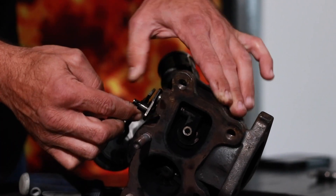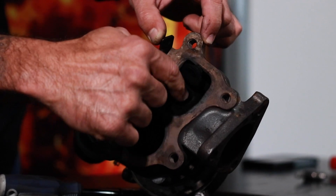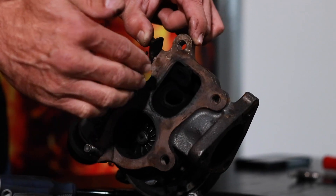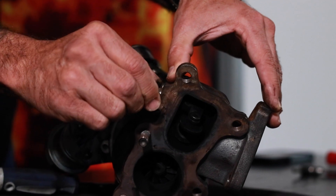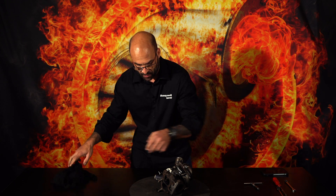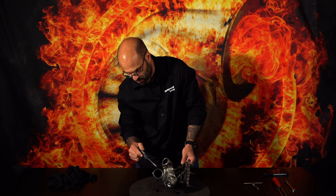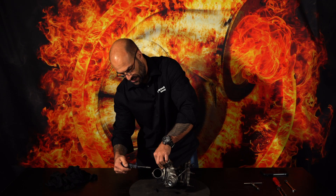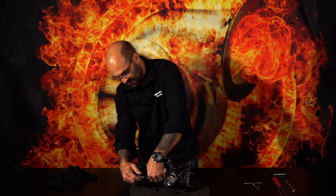I'm going to pull this little arm off and you'll see that the swing valve moves freely. First thing we do is inspect the actual swing valve sealing face. This turbocharger didn't last very long, so it's highly unlikely this sealing face has got any cracks. There's no abnormal play, no axial or radial movement inside of the bush pressed into the turbine housing. I'm going to remove this intake pipe to see what the compressor wheel looks like inside the compressor housing. This turbo hasn't been disassembled yet — this is the first time we are disassembling it.